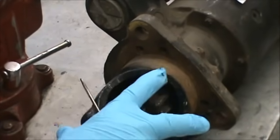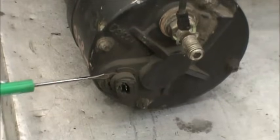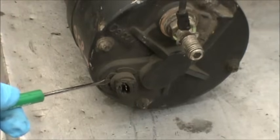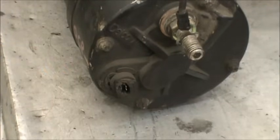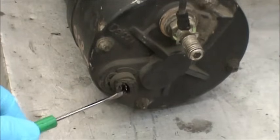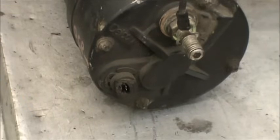You'll also notice the rotatable nose. You can take these out and put the nose cone into any position you want. This unit is also equipped with Delco's OCP — Overcrank Protection. It's just two little pins. This one's been damaged, it got dropped on it, so it's going to need to be replaced. If you try to overcrank, there's a thermostat on the inside that opens up these two pins so the ignition switch can't make continuity. Then when it cools back down you'll be able to crank again.